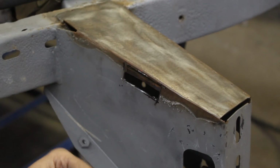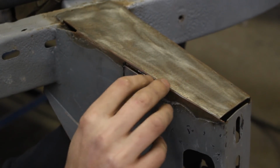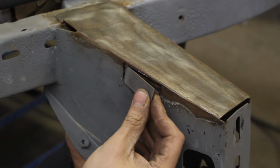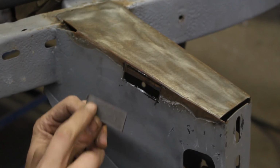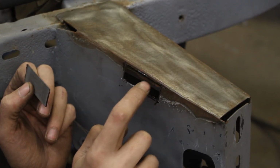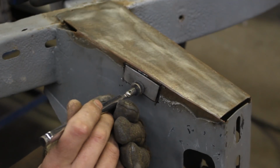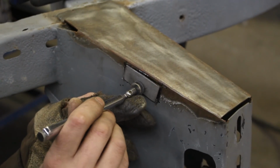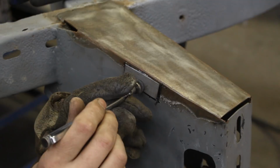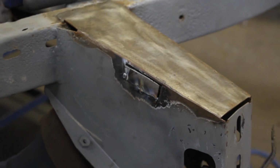So now when I'm welding this there, let's just make it a little bit smaller. I'll make sure that I have a very good penetration here on top, so I can weld them both. Actually, what I'm gonna do is I'm gonna cut this shorter, so I have a gap on top, so I have a bigger penetration there, and I can weld also the inner piece. So I'll make a pretty good gap here. You see? That's how I'm gonna do it. I can weld everything at the same time. Okay, so I have to push the inner piece out too, like this.